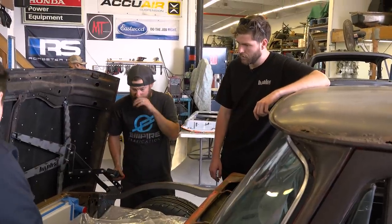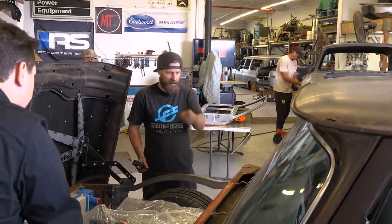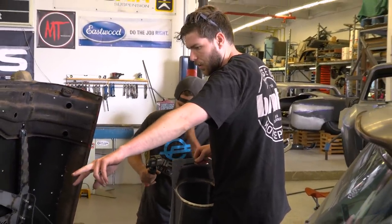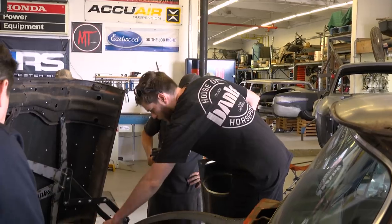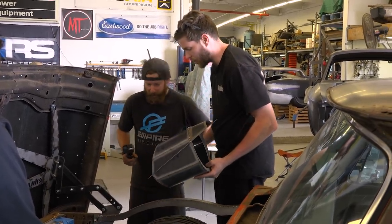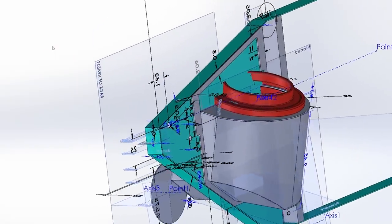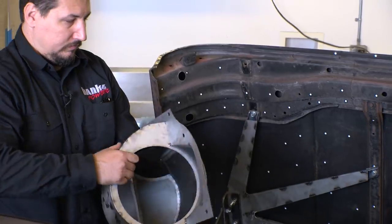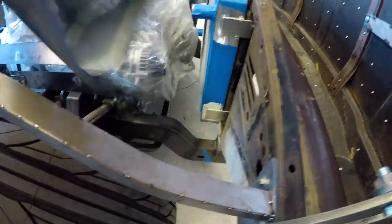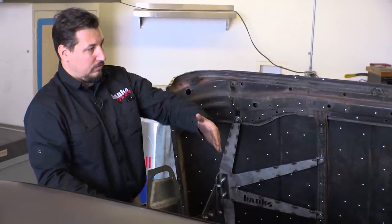And then the intakes — do you guys have anything for mocking up the intakes right now? This flange is the same as that one over there; that was our cutting jig. Those two bolts are locating pins — we drilled the same holes over here. So this 14-gauge flange is going to meet up, and that cut line is the same profile as this flange. Ultimately we're going to have a piece of five-inch tubing here that goes to the headlight. We're going to have the velocity stack — a real short piece here, and this is where the filter drops in. It'll tuck up and in there; we just didn't have time to make that cut. And that clears the tires, barely — there's a gap in there at full turn.